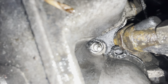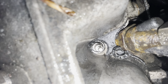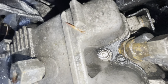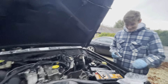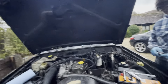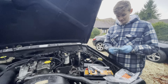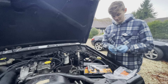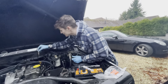As you can see, there are a few contaminants — like a bit of broken plastic. We're having to pull them out with a penknife because we can't screw the plug in otherwise. We're going to take those bits of plastic out and put the last glow plug in. It's actually quite impressive considering we've never done this before — we love cars but as far as mechanics go, we know nothing. Replacing the glow plugs really isn't hard to do.